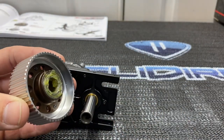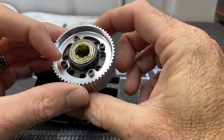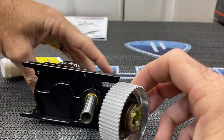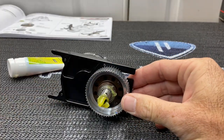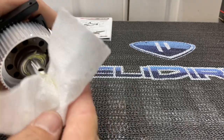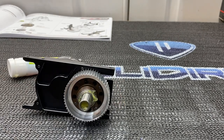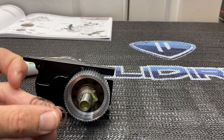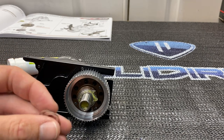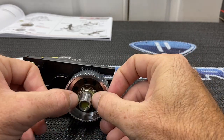Note the direction: the side with the screws goes toward the flat side of the transmission assembly. Slide it up — grease pushing out is okay, wipe off the excess with a paper towel. SAB's manual says three shims, so we take three. There are four here so we take one away. Slide three shims onto the shaft: one, two, and three.